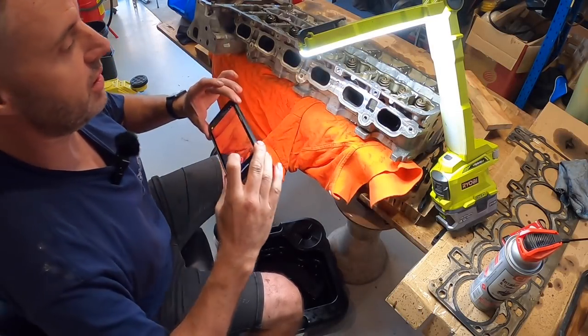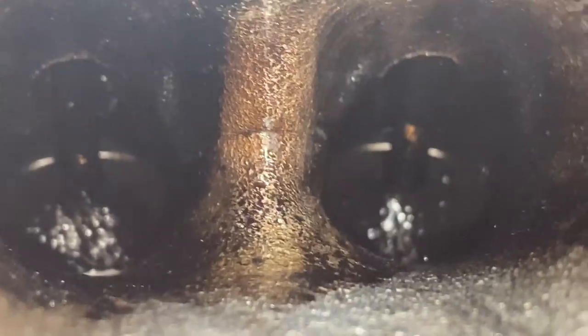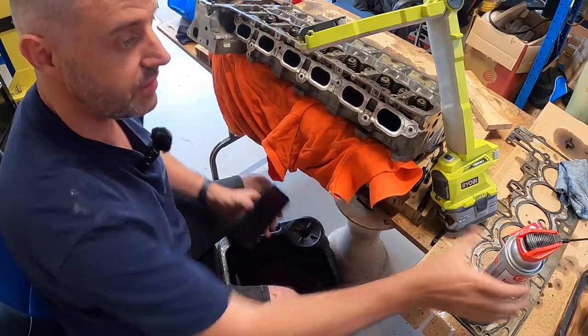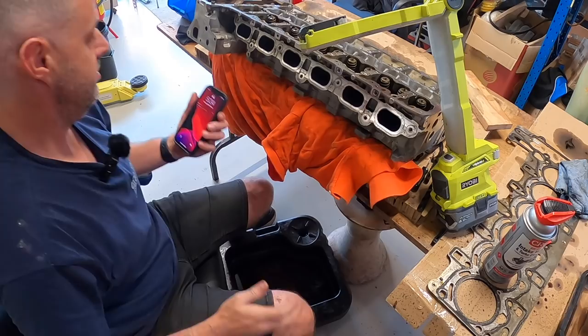So far the CRC is way too much work. The cylinders are fully emptied now — that's half an hour after starting these two cylinders. They need at least twice the amount of work. Cylinder two — you can see it's breaking the carbon down but there's still a hell of a lot in there. The CRC stuff does seem to work, it does dissolve carbon, but it's probably used up half a can just to do those two cylinders and they're not done.